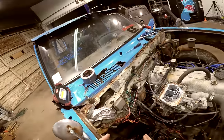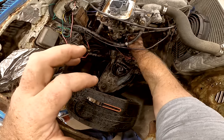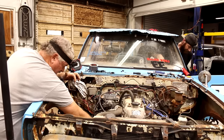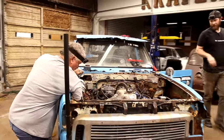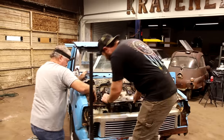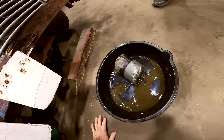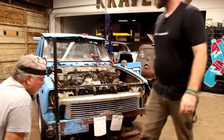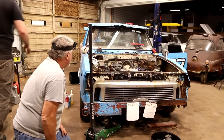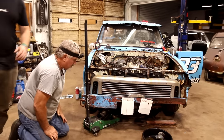That oil's kind of milky looking. Is it really? Yep. Yeah. That's not good. I may want to check it again. Pretty bad, huh? It was. Of course, I've... Let me grab that out from underneath there so you can see. Yeah, kind of. I hope it don't have a blown head gasket. Which, if it does, that could have been...